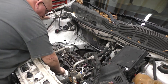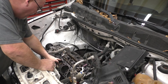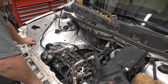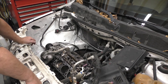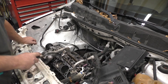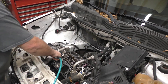As for the surface here, it doesn't look really good — the top has a lot of pitting. I suspect it'll be good enough to seal, but it really should be decked. Truth be known it ought to be replaced or decked. I don't think that's in the stars for this vehicle though. The other thing I do is check the cylinders — make sure you don't scratch the cylinders.